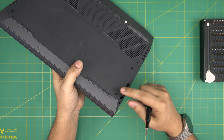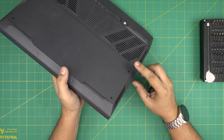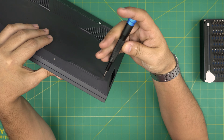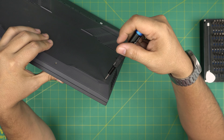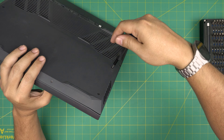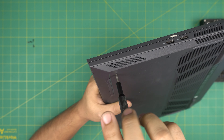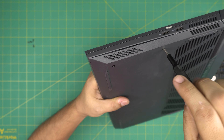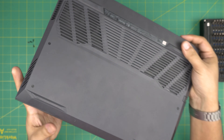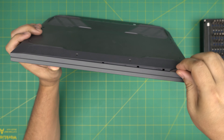The rest of the screws have a c-lock. A c-lock is on the other side of the screw to prevent it from coming out entirely. The reason for the c-lock is to help you separate the case from the bottom cover — as soon as you start rotating the screw, you'll see a gap opening between the covers. You want to hear that click sound and then stop. Same thing on the other side — just loosen them, don't remove completely. If yours isn't opening all the way, wiggle the guitar pick in and twist it.